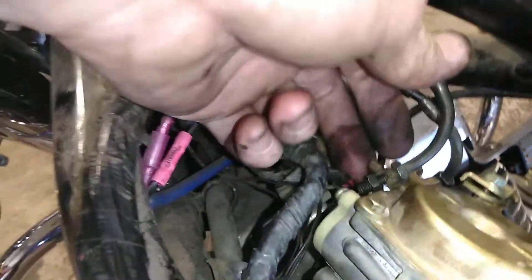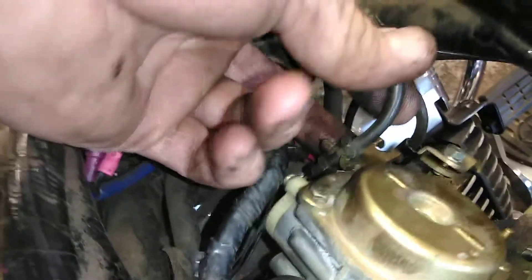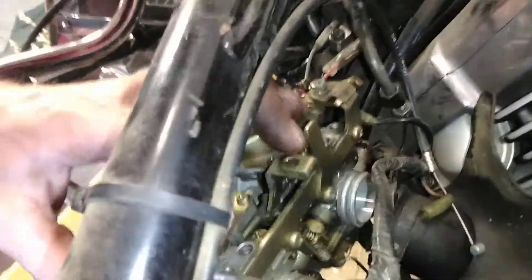When you undo your throttle lines, a lot of times I just move one nut or the other so you can put it right back to where it came from — I did the top nut on that one. This does have a hose that comes down — that black hose there comes down underneath this flap and hooks to right there. It's probably some kind of warm intake deal or something, or it leaks gas in there, so make sure you know where that goes.